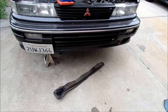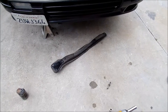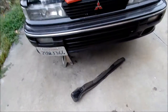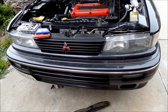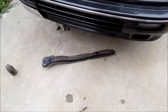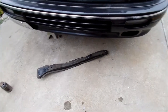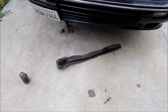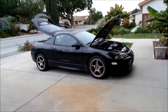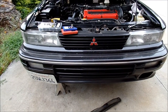Maybe I'll put it back on. I'll see if I can get that bolt out — we'll see how easy it is. If it ends up being too much work, I won't worry about it. It is a stiffening brace — it's there to add rigidity to the front of the car. So it would be a good thing to fix that busted bolt. It's basically a tie bar — it ties one part of the frame to the other, kind of like a strut bar but longitudinal. I'm going to clean up and go get some more distilled water. It's full of water now — all the way to the filler. It really only needed less than half a gallon, and I poured whatever was extra into the overflow.